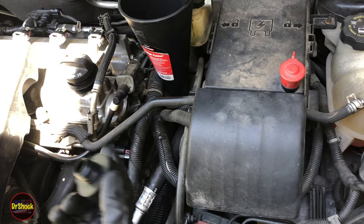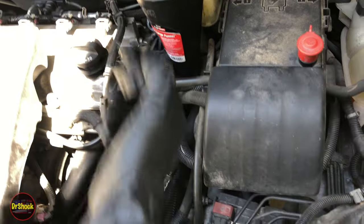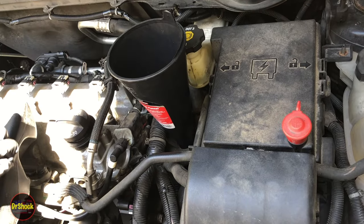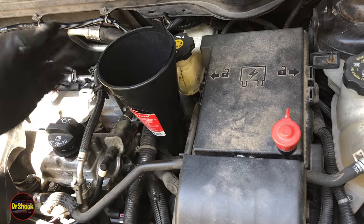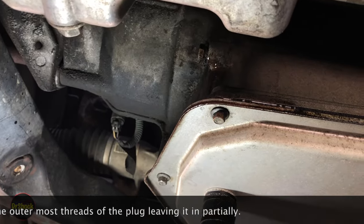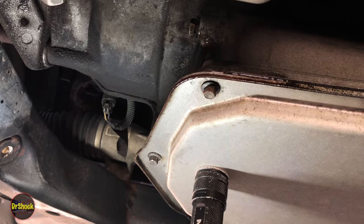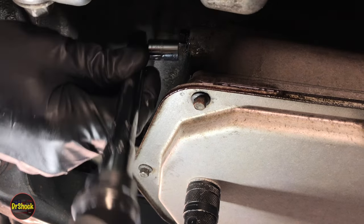We're going to put the cap back on — clean it off first since it's typically going to be dirty. There's a vent in this thing too, so another reason to keep it clean. Then remove the funnel and put it back. Now, if when you removed the plug nothing came out, you would have added very slowly until it started drizzling, like we saw. This vehicle was actually a little over, so nothing to add here, but it would have been the same process. You can top things off by putting in as much as you took out before pulling the funnel.